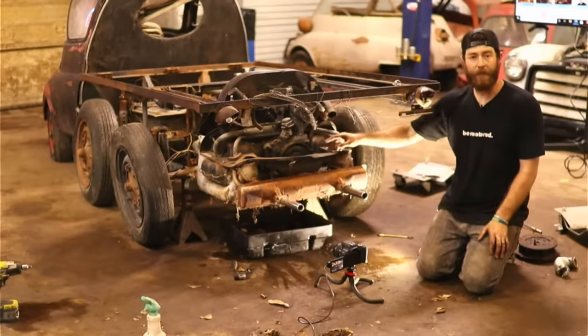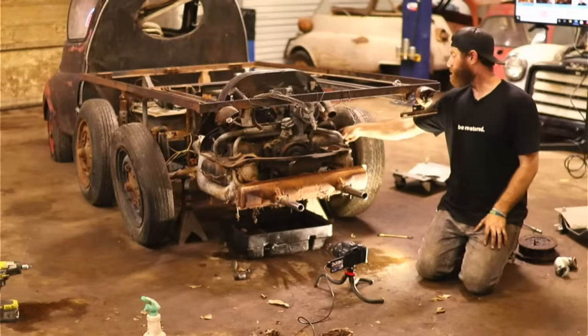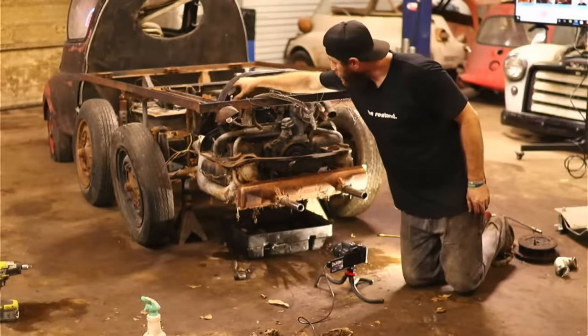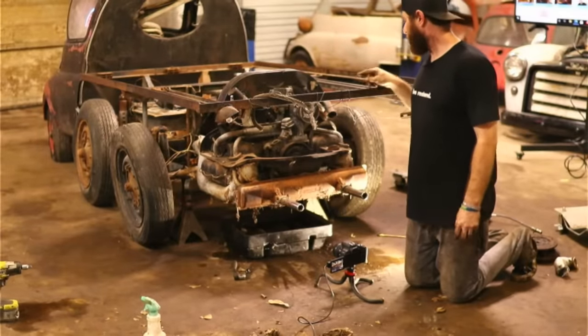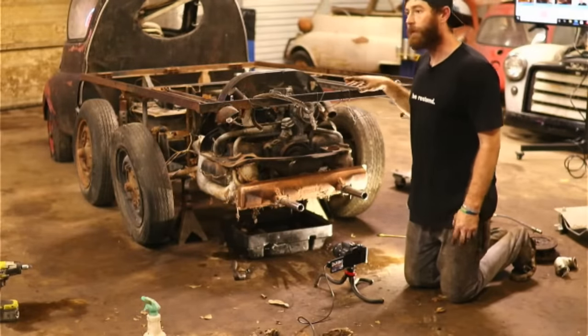Okay, we'll go ahead and get everything on top dead center to put that distributor in and make sure everything's right on that. And then hopefully we're getting fire. I don't know about this old coil here. We may have to, yeah, that old coil is not going to work, I don't think. So we may try to find a different coil as well. But right now, I'm going to put that plug back in there, put some oil in it, turn it over again.